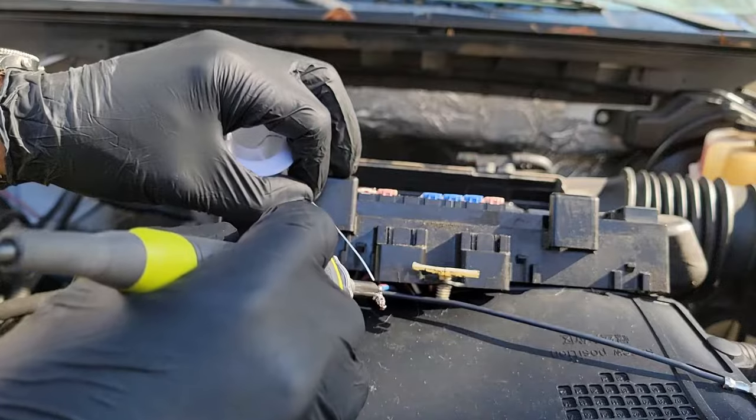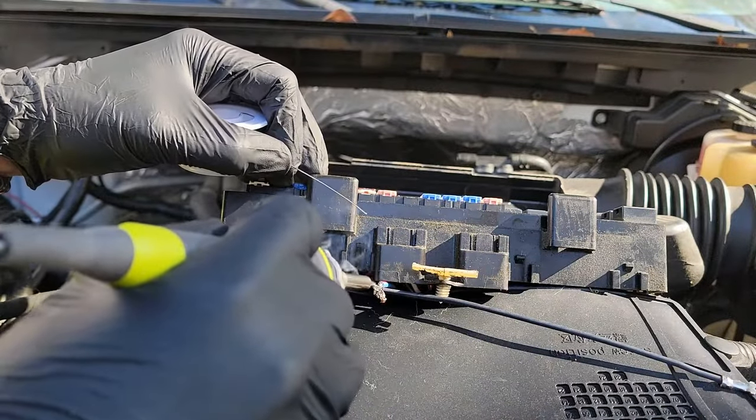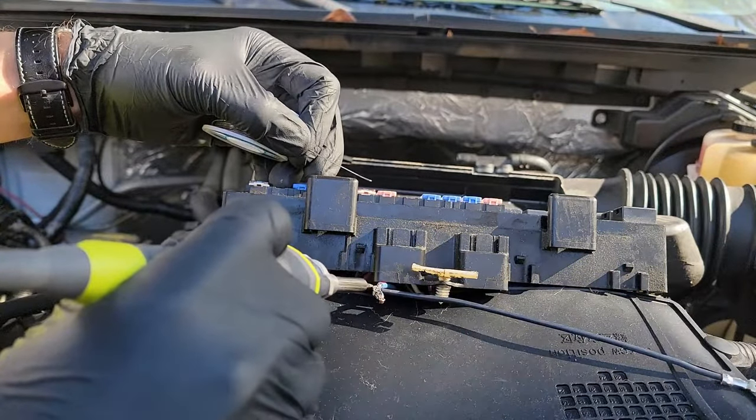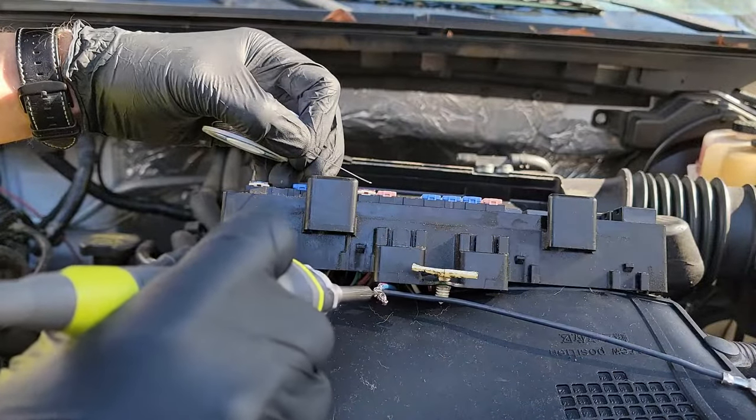Once you feel like you have added enough solder, take your gun and rub it over the solder you laid down. Make sure you keep moving the gun back and forth to prevent burning the solder completely off in different areas. This will smooth out those areas that are rough because you forgot or neglected to use flux. Lesson learned.